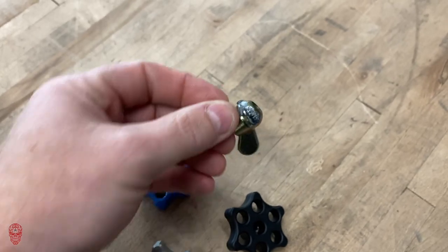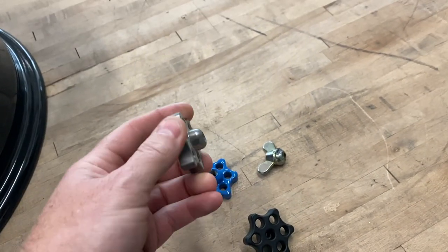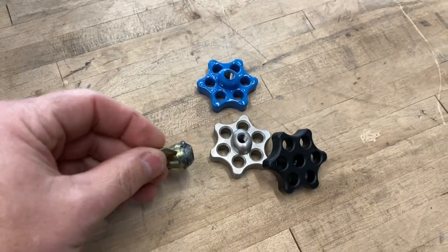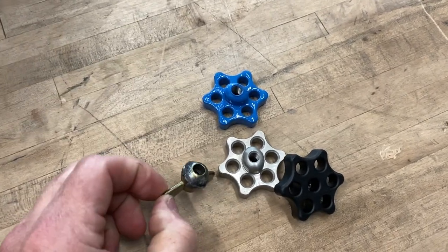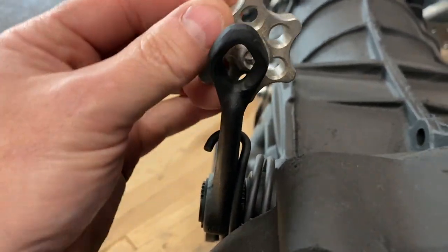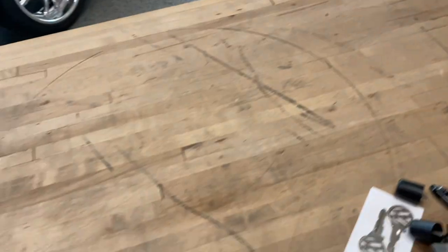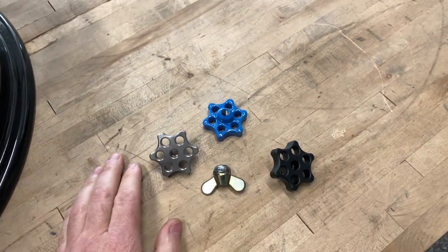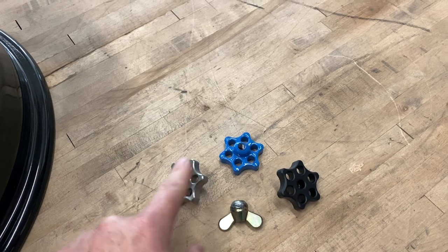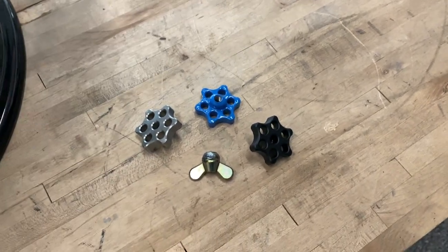So we took off what we had on the vehicle and put on one of our six shooter adjusters, which allows for easy incremental adjustments. As you can see on the back, it matches even the oval on this — it's kind of all worn out, but the original was made with junk steel. The six shooter has the same shape so it fits into that slot and holds nice and taut. Six shooter's in, clutch is adjusted, works sweet. Links for stainless, raw steel, and black powder coat are in the description below.